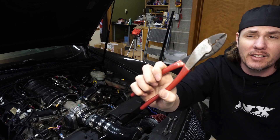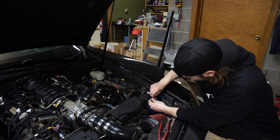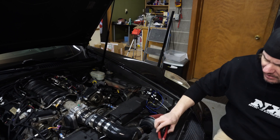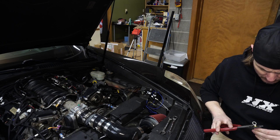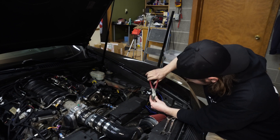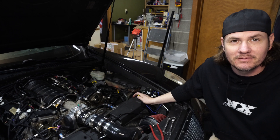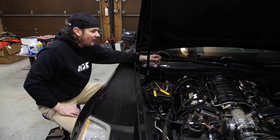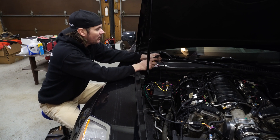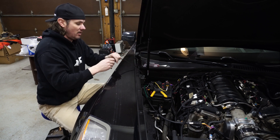Go ahead and give the wires a little bit of a reef twist. I always like to load up my terminal in my crimpers and then add the wires. Get her smooshed down real nice and good. Tug test — now that's a good crimp. I've got my solenoid wires pulled over — green for go, white for blow fumes out the front. I'm going to go ahead and hook up my purge switch to the wires that I pulled from the engine bay. Yellow is my purge. Go ahead and strip back a good chunk of wire there.